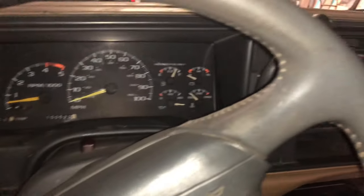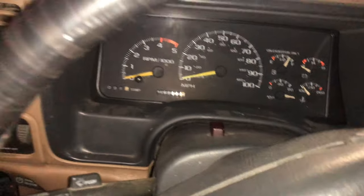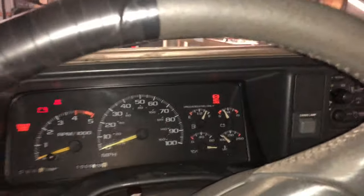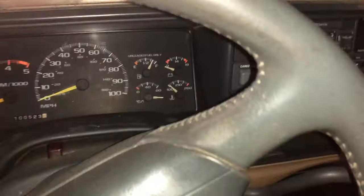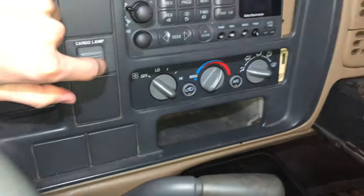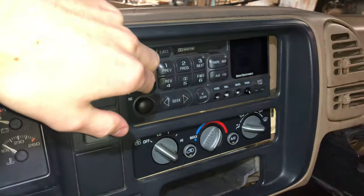To get this out of the way, you're going to need to turn the actual key on, push on the brakes, and bring it all the way down, then turn the key off and take it off, because you have to have that off before you can take this out. After you get that off, you've got the headlight cables and the cargo lamp cables that you need to undo before you can actually take this out of the way to get to the stereo.